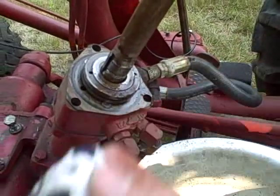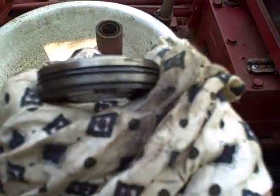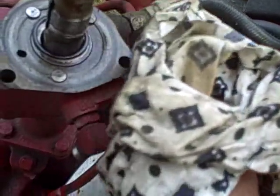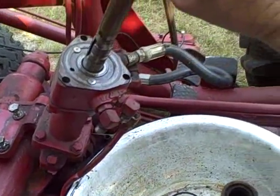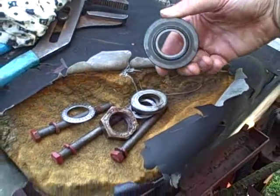There's another spacer here with an o-ring on it, but the o-ring looks lost in that groove — it might be the wrong sized o-ring, or perhaps that's by design. There's also a groove on the bottom with another o-ring in the same situation — the o-ring is so small compared to the groove it just falls out. You can imagine putting it back in is fun, since it's going to want to fall out every time. A little grease would help keep it in place.